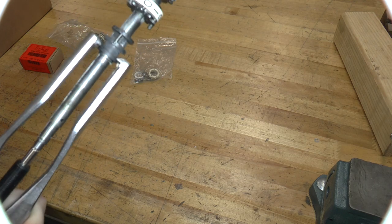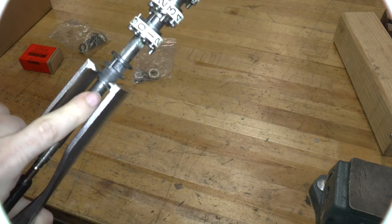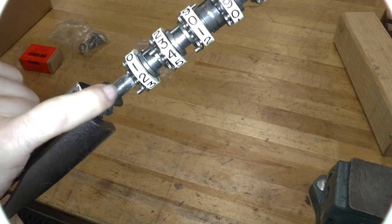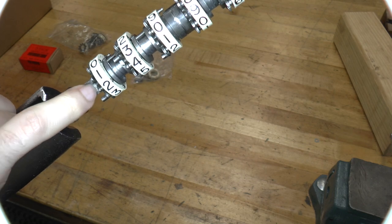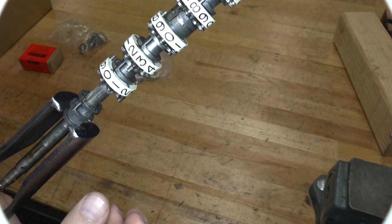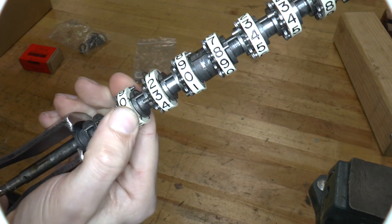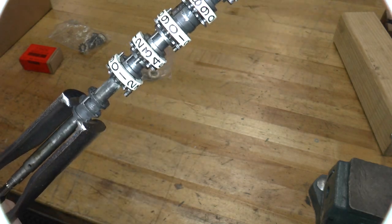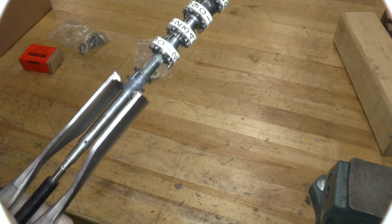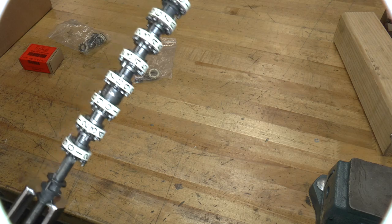You can see right away that there is some sort of a waxy buildup — that's basically the grease. And if you look inside here, there's this discoloration. I'm touching it and it is really, really sticky. This is interesting because this wheel should be loose and moving, but it's not. It's effectively glued into place by the grease. So I'm going to remove this, and then hopefully in fast forward we can see all of these get removed as well.